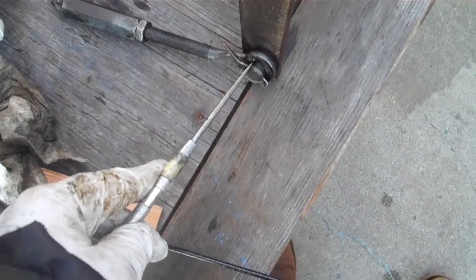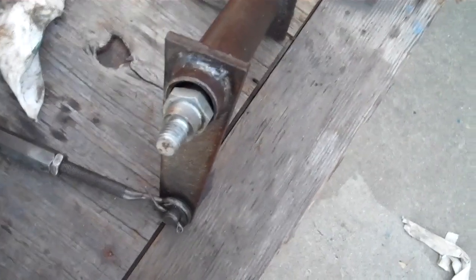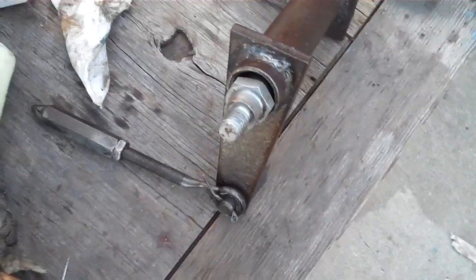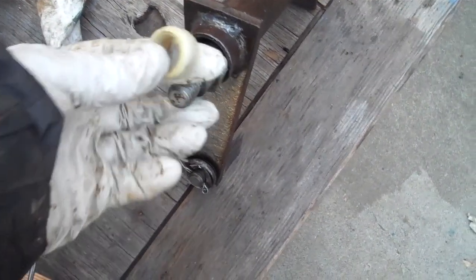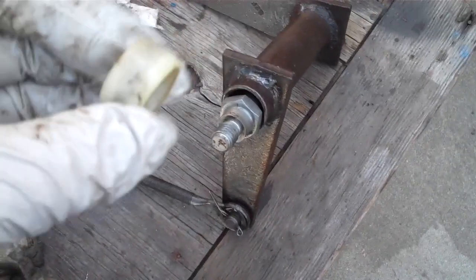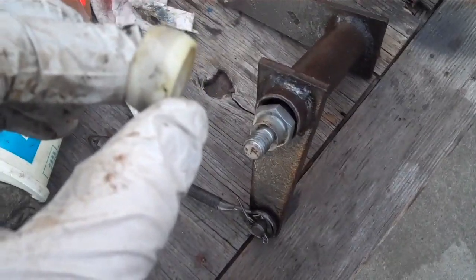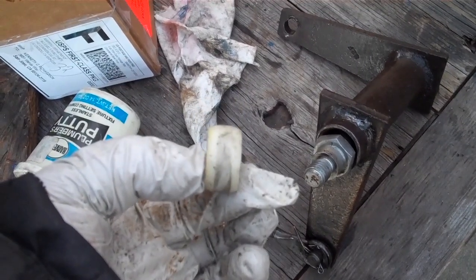Okay, this is the clutch linkage. I've got a cotter pin here, a thin washer there, thin washer on the other side. And I just discovered that the bushing is flattened out — I should have purchased one sooner. That bushing there goes around that portion there, which fits in there so it rotates, but it's gotten flattened. Bummer. $2 a piece, $4 shipping.